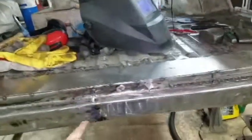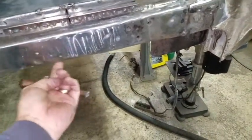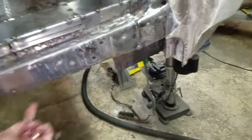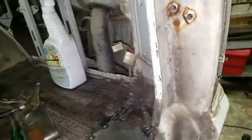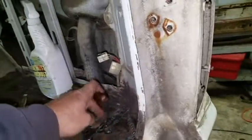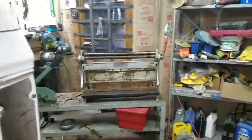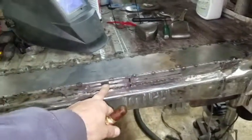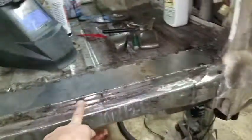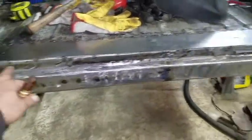This whole thing was just swiss cheese metal — you could push your finger through most of it. I had to cut that away and graft in some new pieces. This part up here was fairly solid, but I had to graft in a patch down here. I had to take this all the way over to the edge until I found some good metal, then I just started building back. I'm still reconstructing the valence here. I have to put the weather stripping tab back on — thankfully I've got a sheet metal brake, which makes that job so much easier. I can bend these alignment tabs so I can keep track of where this is supposed to be.